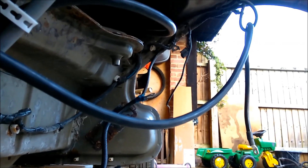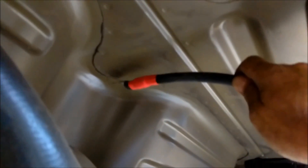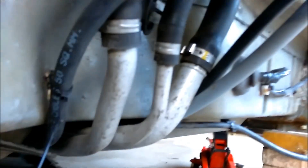I've just got the cables in under the car. You can see the longer negative cable routing down there, and then the positive cable which is going to go up to the isolator is running down under the car. I've also put in the 15mm tubing, so all those cables are now running up under there. The 0V is this one. I've left the standard cooling pipes in place as well, just in case I ever wanted to use them. Then there's the 15mm tube and the positive line, and they go off to the front.